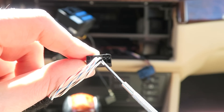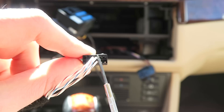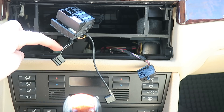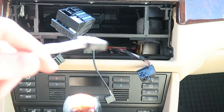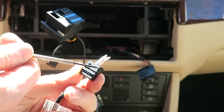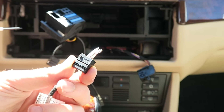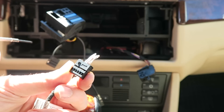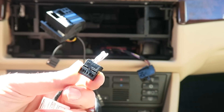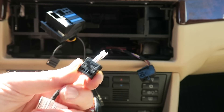Here are the three new wires for the auxiliary function. We have four more ports available. We're going to skip the first two windows and use the last two. If you look closely at the corner of this connector, you'll see a number six and a number one with an arrow. We want to make sure the orientation of the existing wires — the black and white and the black and brown — go into the new connector the same way they are positioned in the old one. The black and white wire goes into pin number six, so I'll use that six as my guide.